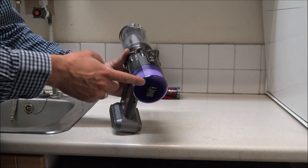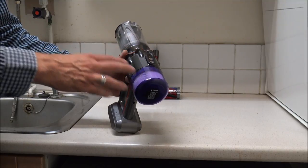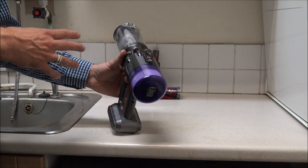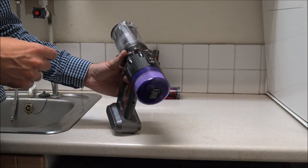The second thing is just to make sure the filter is nice and clean — something I'd recommend doing probably once a month or once every couple of months, really depending on how dirty the home is that you vacuum in. You can find sometimes, especially if the area you vacuum in is quite dusty or dirty, that cleaning the filter is needed more often.